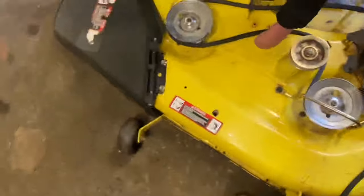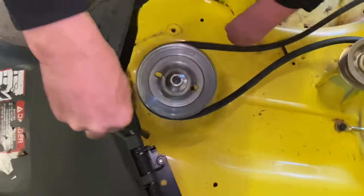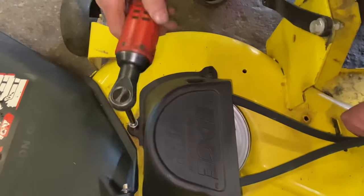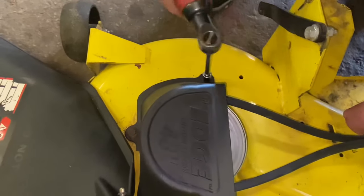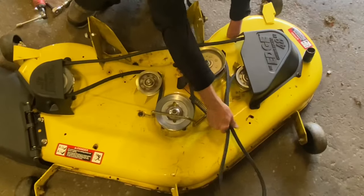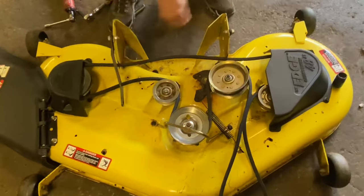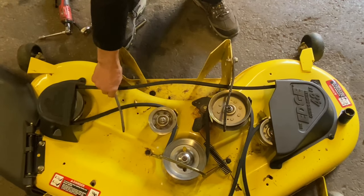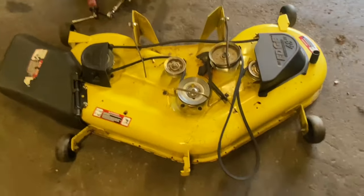We've got the one over here — same thing with this cover. Turn it upside down and you've got a guide on one side and a guide on the other, which helps keep that belt on the pulley. Make sure the belt is around the pulley correctly, then put the covers on and put the bolts through. Don't crank these down too tight — if you crank them too tight, you can break the plastic. Just snug them up on the plastic. Make sure these hangers here are in the in position before sliding the deck back under — a lot of guys leave them in the out position and have to pull the deck back out to flip them. If you liked that video, please give it a thumbs up, subscribe, and thanks for watching.